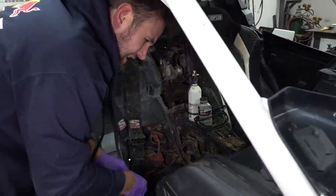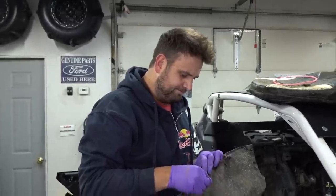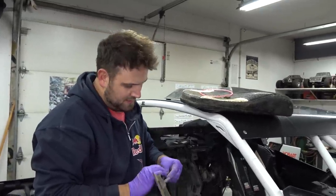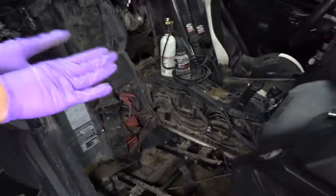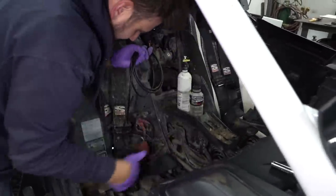This is what I didn't take five minutes to do when I installed the wideband, which is why I have wires just hanging out. Not even sure if we documented the wideband install - it was a last minute thing right before race day. PLX Evo wideband - it's on the unit to track your air-fuel ratios to make sure you're all good. Works great. Beast mode dialed in, plugs into the map tuner so you can see your AFRs live and data log them. Okay, so let's do a good job routing from the sensor.